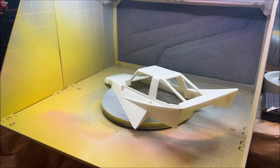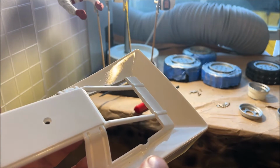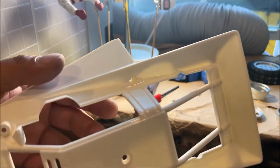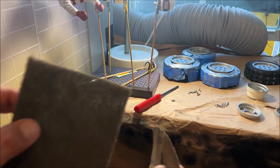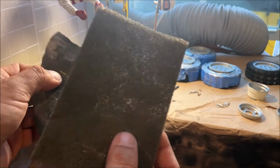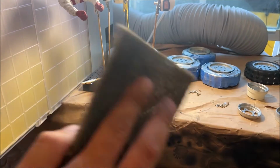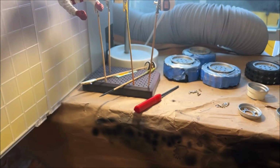Walk away from it. I put 3 light coats on there. See how it's got that little orange peel texture look? Don't worry about that kind of stuff. Just let this thing cure up for a couple of days. There's a bunch of videos on polishing paint, different ways people do it. I would take some 600 grit or a Scotch-Brite in the sink with soap and water and just go over those places you don't like and then get it clean and ready for the final paint job.